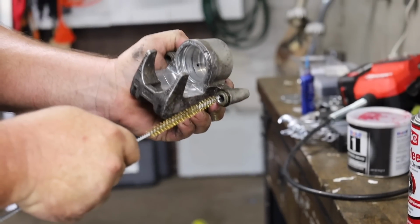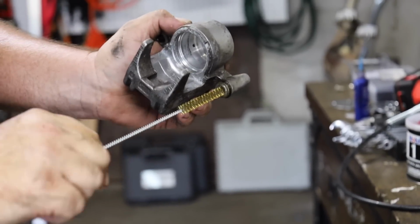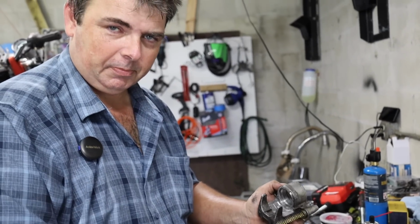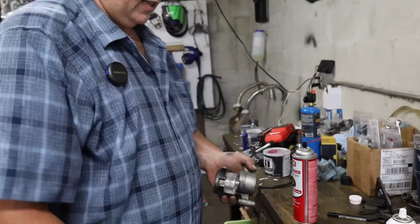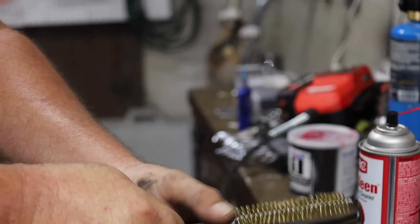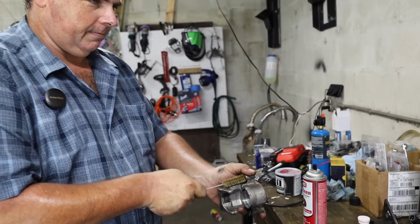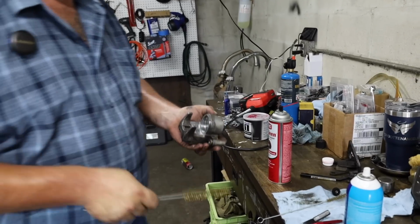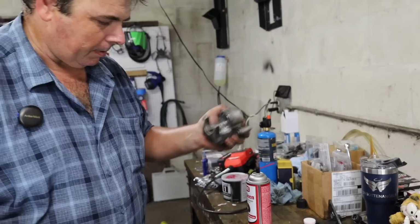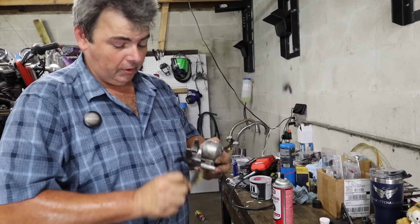Even I got standards. This cavity here is where one of the slide pins on the caliper bracket rides. Usually you don't see them corrode down inside here, but what you do see is, since they get just the tiniest smear of lube whenever they assemble them at the factory, that's the last lube that this thing probably saw since we got a hold of it. You got to clean that stuff out because it turns into this hard, crusty, goopy, sticky, it's like 6-year-old peanut butter. It's gross. Shoot a little brake cleaner down in there and you use one of these little wire brush kits from Harbor Freight. Personally, because I've got a lot of them laying around the house, shotgun brushes on a cordless drill works really well for this.